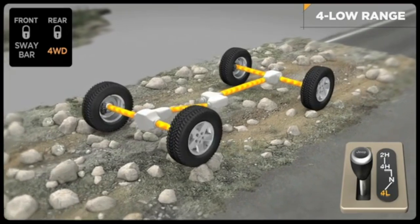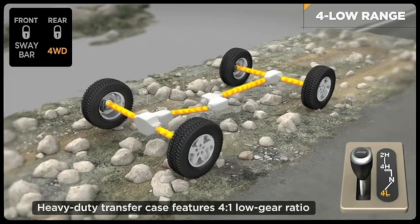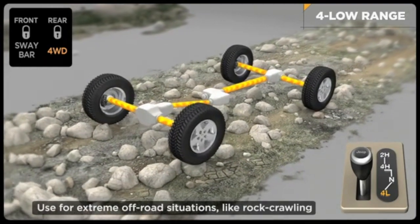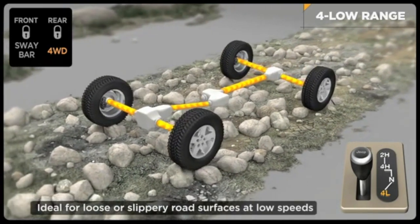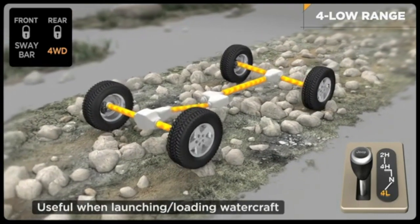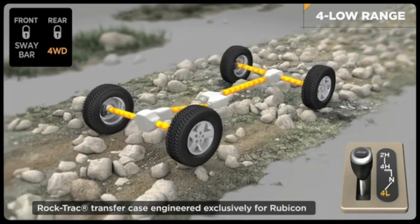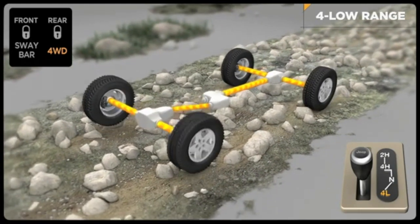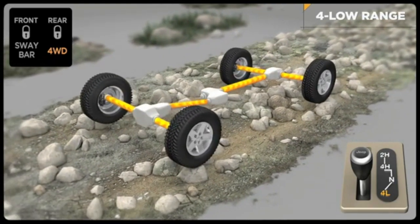Four low range is where RockTrack really struts its stuff. This heavy-duty transfer case boasts a gutsy 4-to-1 low gear ratio — the magic number in the off-road world to deliver massive amounts of engine torque for rock crawling. An exceptional 73.1-to-1 crawl ratio with a manual transmission allows for controlled half-mile-per-hour cruise up the rocks. RockTrack is designed exclusively for the Wrangler Rubicon and the Wrangler Unlimited Rubicon, and operates in conjunction with other hardcore off-road components like locking axles and beefy drive shafts.